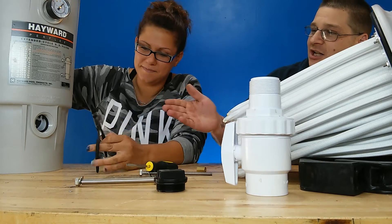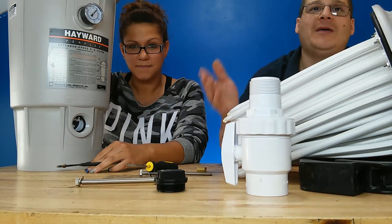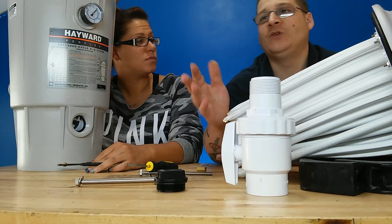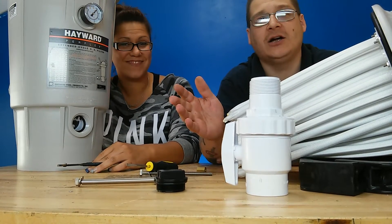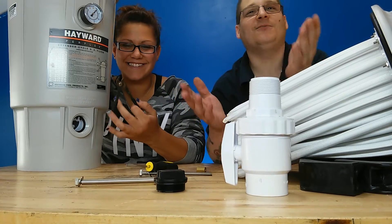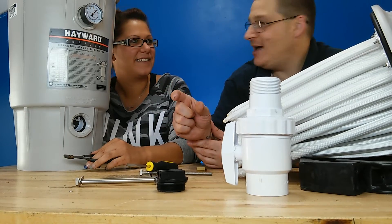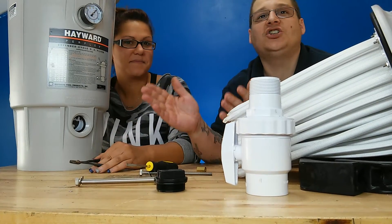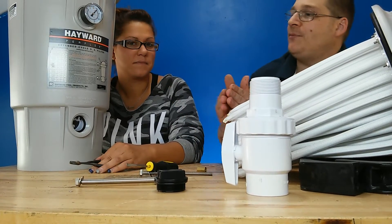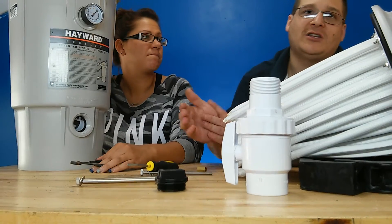What we're going to do is Nina's going to take the channel lock pliers — there's an inner clip or ring inside here that has to be squeezed and then pulled out, and then we'll be able to slide it out. Dr. Gary found the little black round disc in this hole, which is basically the check valve. A check valve is a valve that allows water to go one way and not the other. Because if the pump flowed all the water this way and then when the impeller stopped, all the water would wash backwards as the pump was stopping, whip that impeller the other way, and break the impeller off.